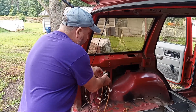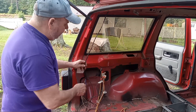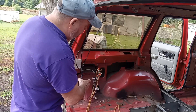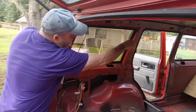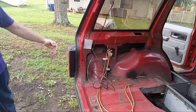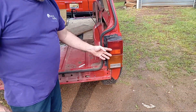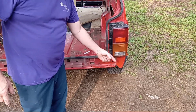To get power to my front running light, I utilized another old piece of three-wire drop cord and ran it up and over straight down to my front. In the rear, we've got brake lights, taillights, left side turn, reverse, brake light, taillight, right side turn, and a backup light.